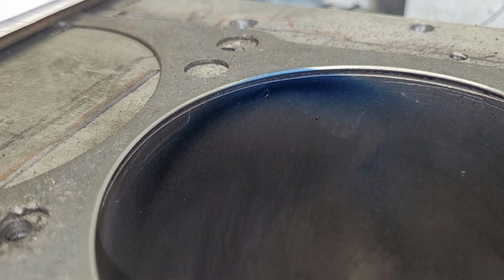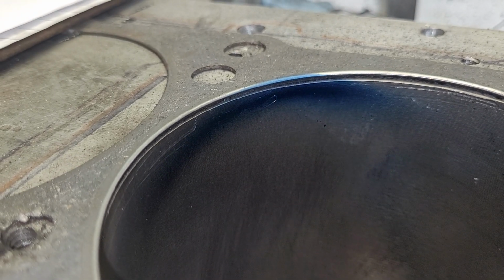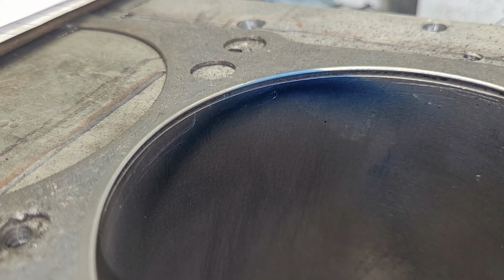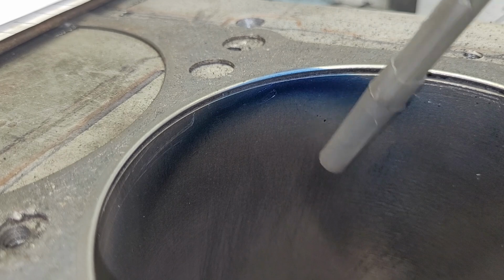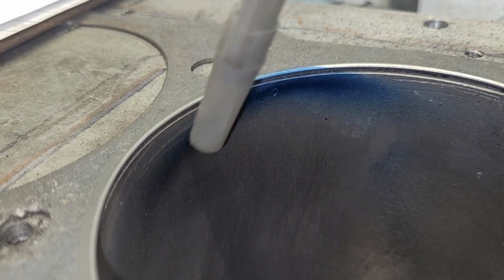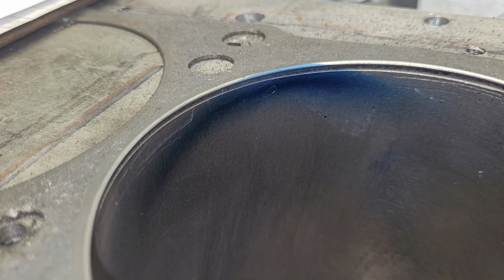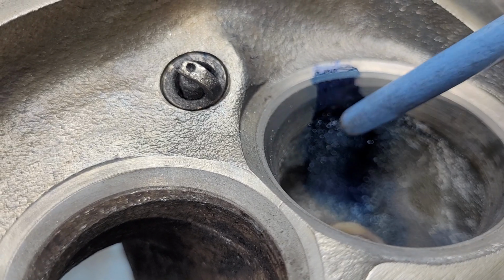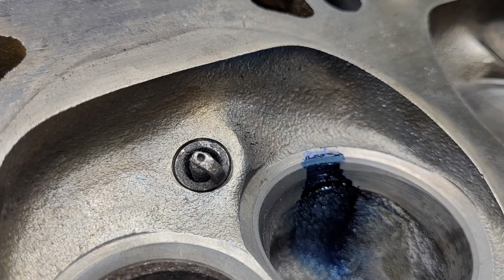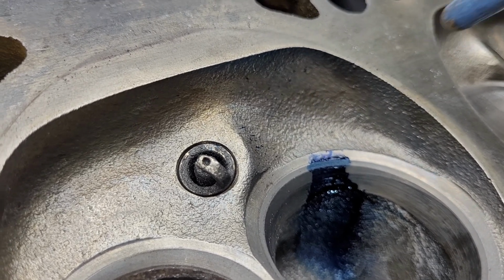The Dykem on the bore is quite a bit different because they are attacking the short side way differently on a Magnum head. It's really interesting what they did. The LA is going to have a big blue mark here. Okay, this is really hitting the corner with the Dykem. Coming right out, hitting that corner with the Dykem, right here. Even though we don't get any on the chamber here, that's what it did on the bore.